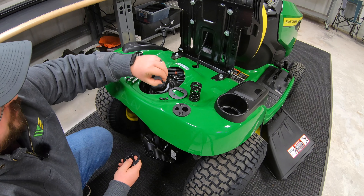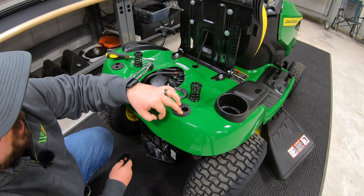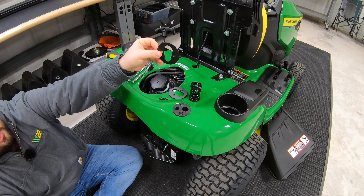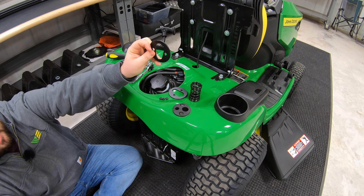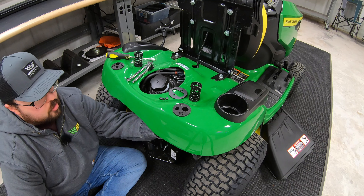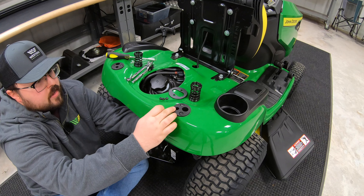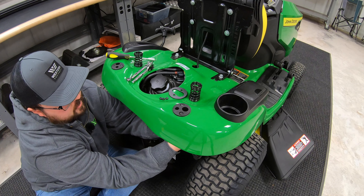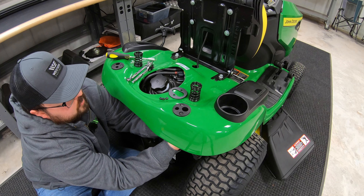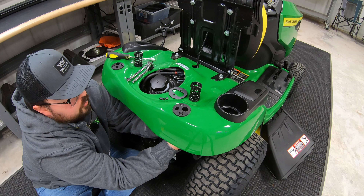We're going to start by mounting our mounting plates on the bottom side of our cargo mount system. We'll take these four smaller nuts, as they're going to go onto the existing screws on our cargo mount system. The hole is larger at the top and smaller at the bottom, so we'll line that up on the bottom of our cargo mount system, fitting around the top on the larger side and around the bottom on the smaller side. Then we'll start the nuts by hand and tighten them with our nut driver.